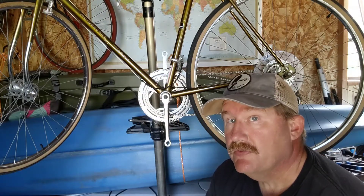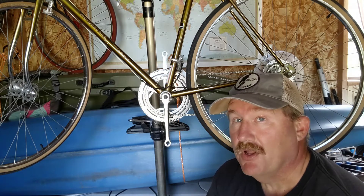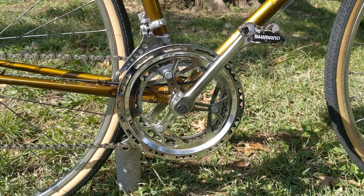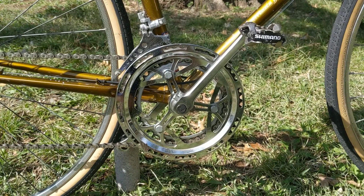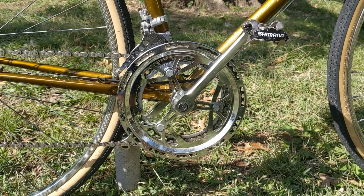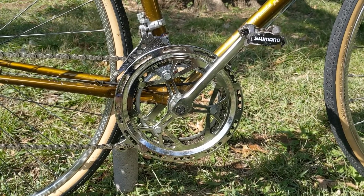It's a little bit of expense owning the tools. If you have a local bike shop — kind of an old-school local bike shop — they might do this for a pretty nominal amount, and that would be well worth it, because as some people would say, you've got somebody else to blame if it ends up going south and you don't get them threaded straight. Here we've got the completed project. In this case I've just put on a set of Shimano SPDs, which is what I traditionally use on my road or mountain bikes. But the point being that you can use any traditional 9/16-inch threaded pedal. New French pedals are unobtainable and the used supply is pretty limited. So this just shows you can transition an older set of French-threaded cranks to new pedals.